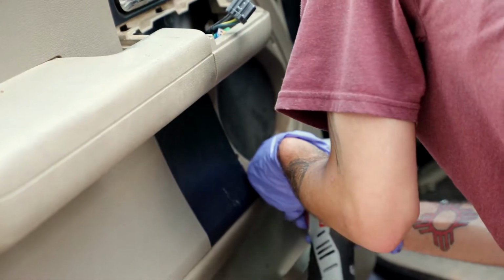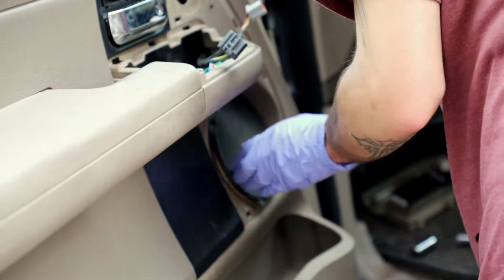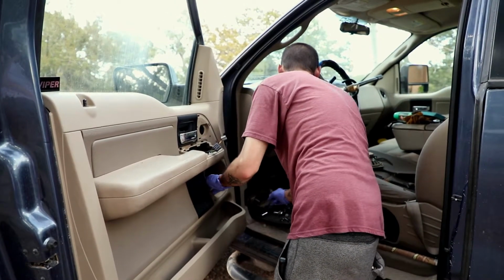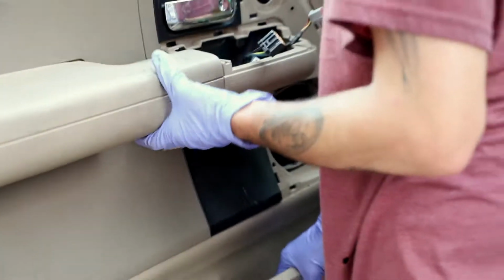So there were a few bolts in the actual armrest, like under where the controls were. So he just took those out. I'm only commentating because I can't really get good angles still. So anything that I can't really get great in camera view, I'll just turn around after he does it. You've got to pull the speaker bolts out, 7/32, and someone's already been in the door panel and broke the little clips that hold the speaker and are in the way to pull the door panel off, and they're very brittle, so you only need to pull the two bottom ones off.